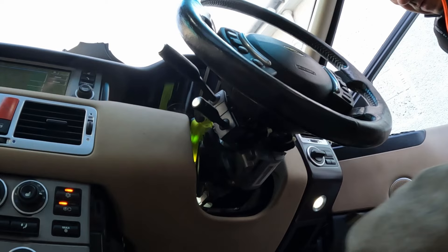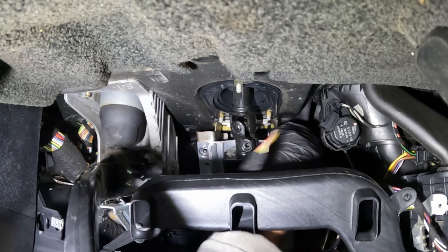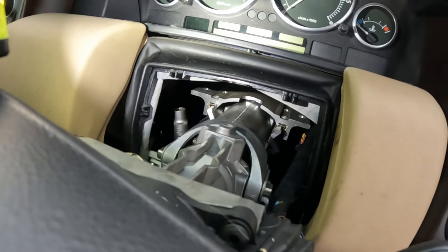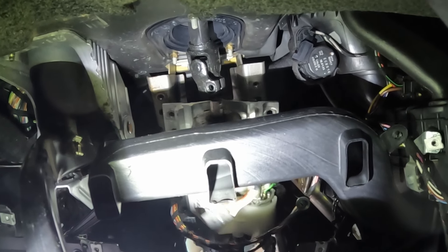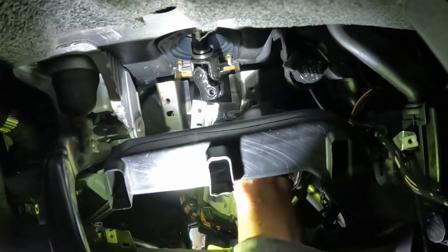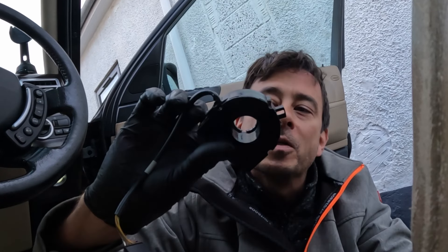That's it all loose. I'm going to remove these bolts completely — I need to reach my hand up in there. I've removed the last bolts; there are four of them. Now I'm going to pull the steering wheel towards the back of the car to separate that joint. That looks like it's separated — remember which way that goes in. And there's your steering angle sensor. One steering angle sensor — let's get on the bench and see if any of the contacts are worn out. I can see it says the original BMW, so there's a very good chance this is the original one for the car.